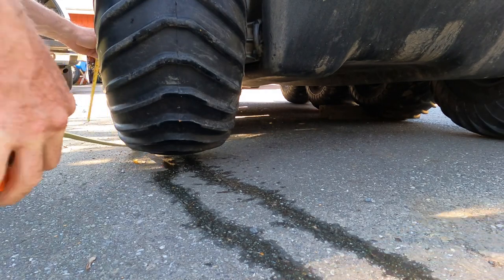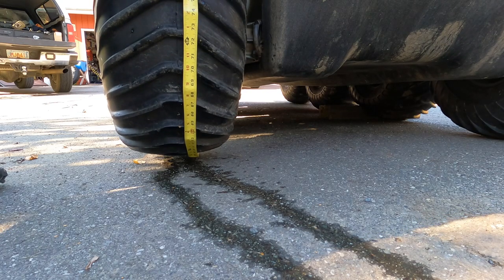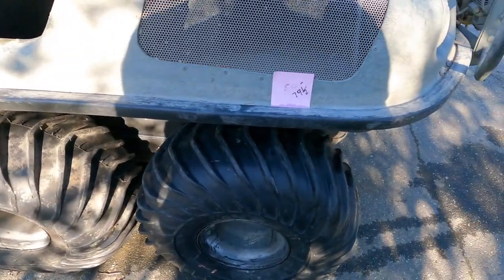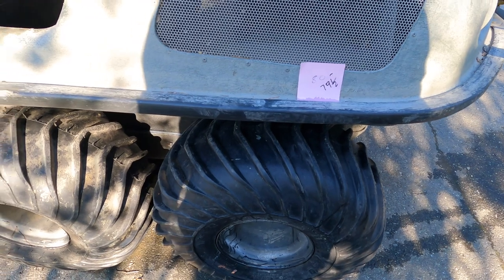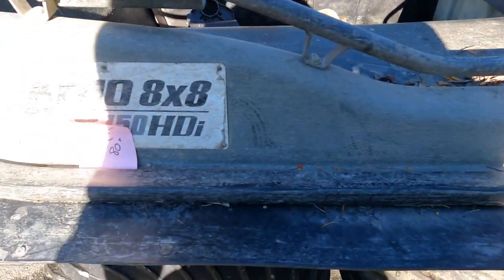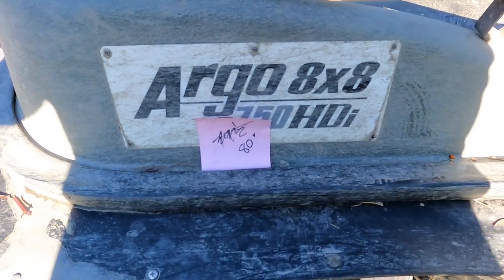Since I have children, my cloth tape measure is of course gone, so I'm using this — it would be better to get cloth, but as long as I'm the same inaccurate on everything we'll be fine. I've put exactly five pounds of air pressure on each tire. On this side — the right side — I had to put a spare tire on here so I've had to rearrange the tires. When you set up tracks, the biggest tire should be the second tire back, the next biggest the third tire back, then the last tire, and the smallest goes on the front. Mine is set up at 79.5, 81, 80, and 80. This is set up for tracks.